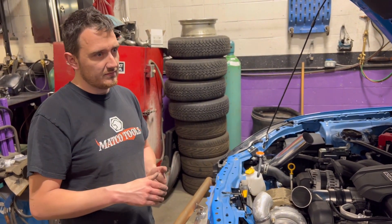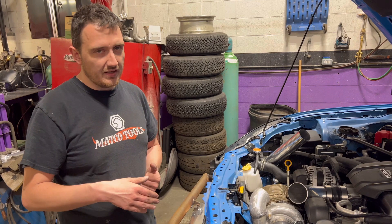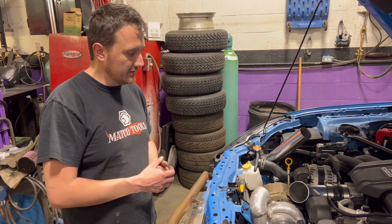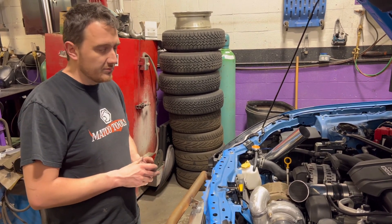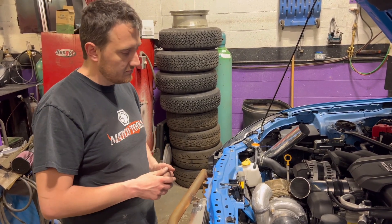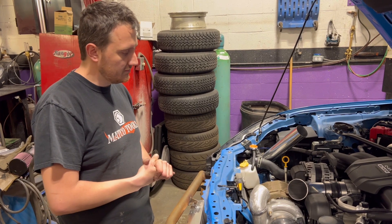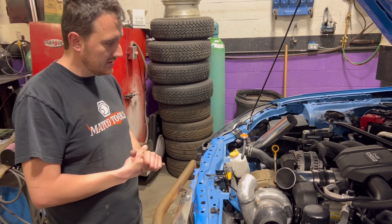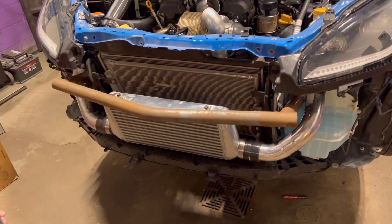One of the things we're going to do is push the non-intercooled setup as far as we can on pump gas. Then, with the same boost and everything, we're going to hook up the intercooled piping and see how much power the car picks up at the same boost level. From there, we're going to turn it up to 14 to 18 pounds and see how the car performs. Next video we'll have all the piping together, and on Wednesday we'll be going to the dyno and we'll make a whole video of that for you guys.